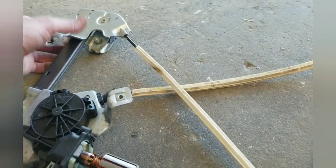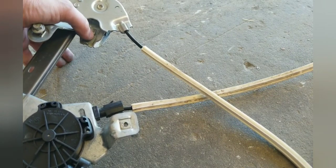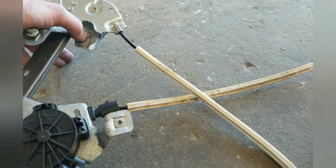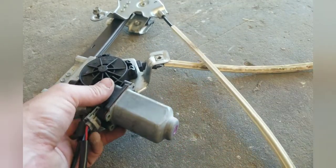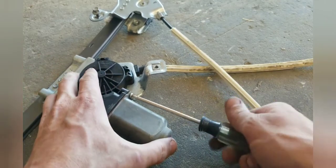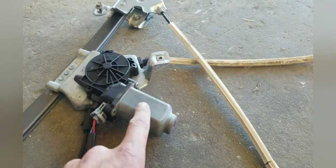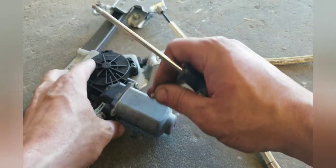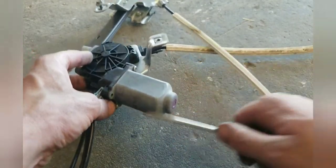When you're into this position — fully up — this is how you'd want to do it anyway, to be able to get to these bolts. I was able to roll the window all the way up, and then put this thing all back together. I put the cap back on and put just a couple of screws in it to hold it. You need the resistance from the magnet of the motor, because if you leave this off, the weight of the window going over bumps will eventually push it back down. But with the resistance of the motor it can't turn, and it's going to hold it up there just like it normally does.